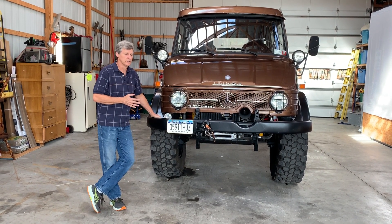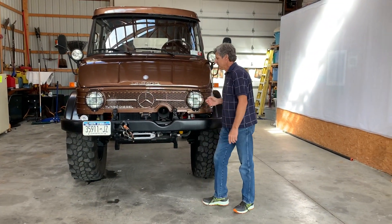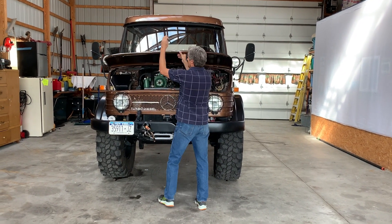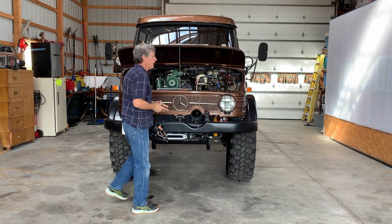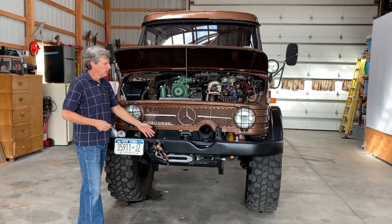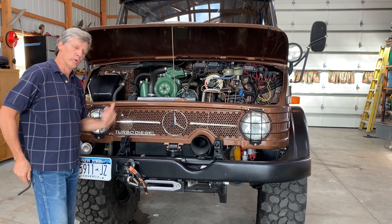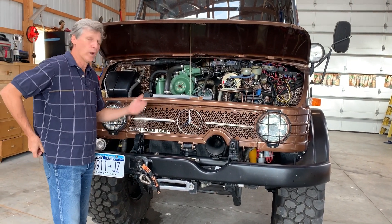Let's do a quick walk around and show you all the parts. All the lights are new, all the emblems are new. Starting under the hood: the truck has hydraulics — there are front and rear winches, both hydraulic. There are quick connects for the front winch so you can put another implement on there. It also has hydraulics in the rear for both the three-way dump box and the rear winch, with quick connects back there too so you can put different implements on it.